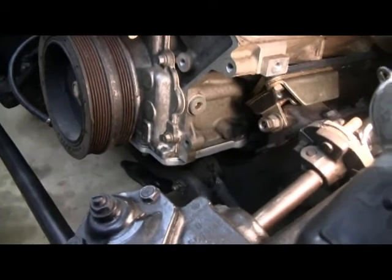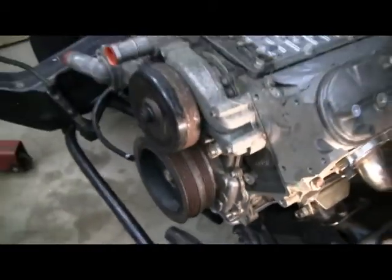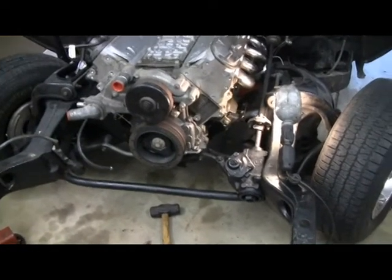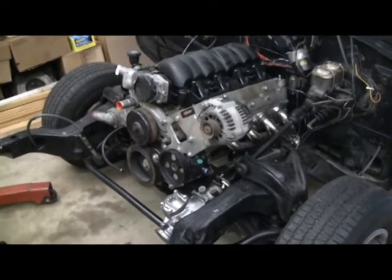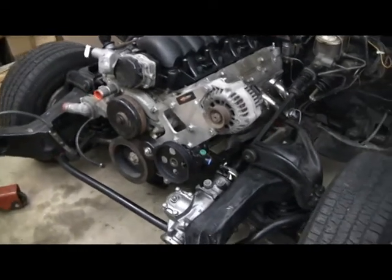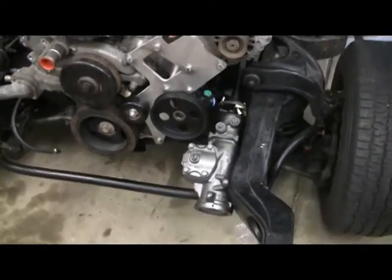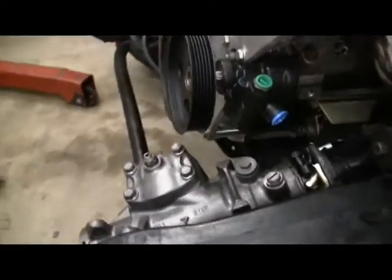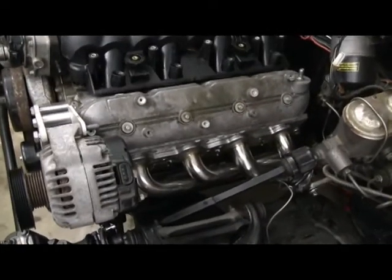So if I used this pan and kept the engine up, everything would clear. But I'd rather sacrifice the steering in one direction a little bit and get all this other driveline geometry in place and the shifter in the right location. Since we lowered the motor about a half inch, I wanted to make sure the accessory drive and everything cleared the steering box. So I put the lsbrackets.com accessory brackets back on and put the power steering box in. As you can see that power steering pulley is a lot closer, but still plenty of clearance — it'll be fine. I also put the headers back on; no problem there.